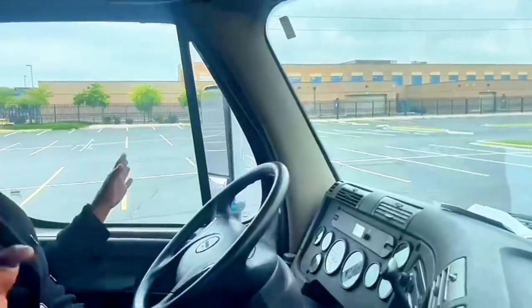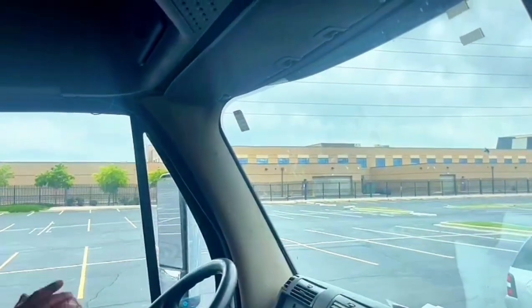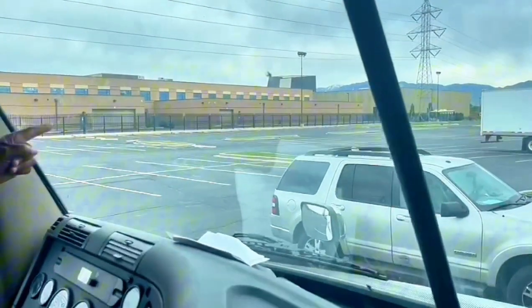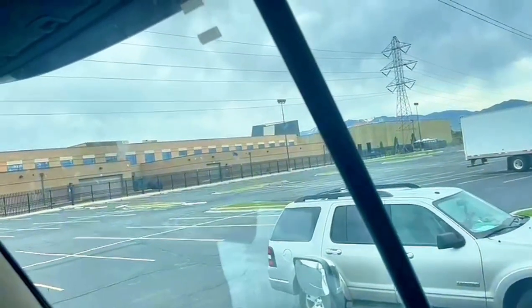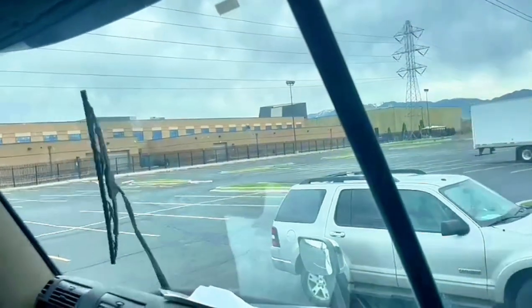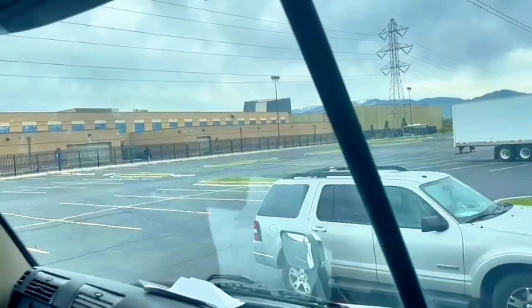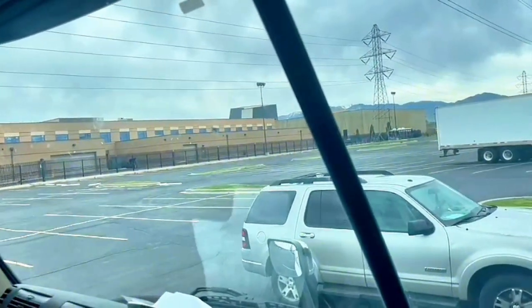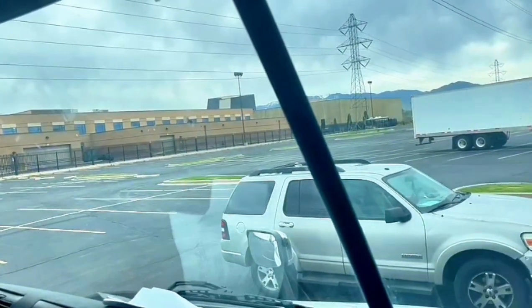Two side mirrors: no damage, no broken, no missing bolt, adjusted to me, securely mounted. Windshield: no damage, no cracks, no illegal sticker, securely mounted. Wiper and washer: no damage, no broken, no missing rubber seal, washing water properly, securely mounted.